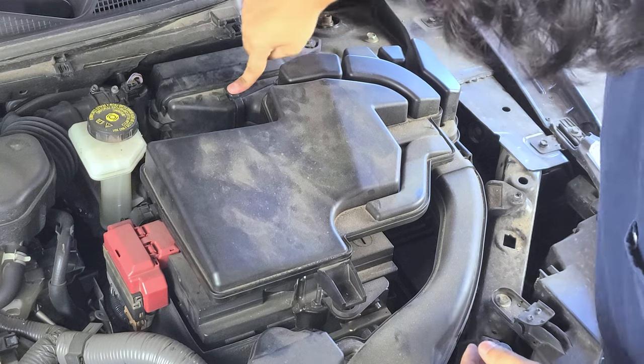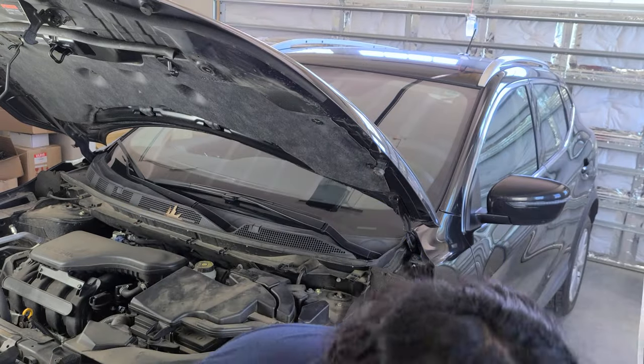Put the last piece back on, press down, and we're good. That was not bad at all. If I knew what I was doing it would have taken a lot less time, but really: open the hood, remove the plastic clip piece, lift off the housing, undo two clips, change the filter, put it all back — that's probably no more than ten minutes. I'm glad I saved the money doing it myself. I really don't want to pay somebody $60 in labor for ten minutes of work.